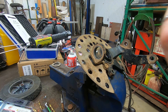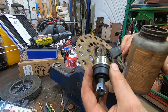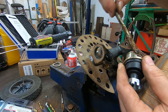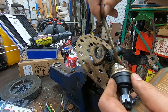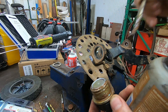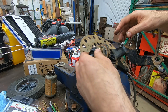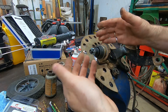Now that we've got the old one out, we have to put the new one in. Here's our new ball joint. I'm going to put a little bit of anti-seize on this just to keep the corrosion out — it's kind of pointless in the environment these things are in, driven through muck, but anyway. Don't make the mistake of driving it down the wrong way — it goes up like this.